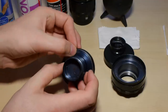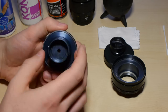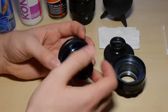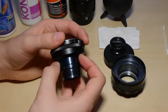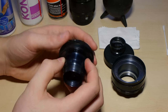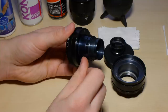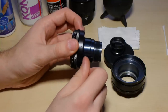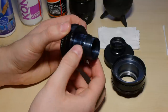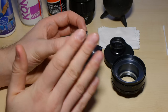You have to unscrew the limitation screw here, then remove this small screw here, which is for the aperture blades — it holds them in place and turns them. Then you can unscrew the whole body here, and if you screw it off you have direct access to the aperture control. You can also add grease under this shell here. The common problem is that there are metal parts inside with dust in there, so it starts scratching, the grease stops working, and it's not dampened anymore. If you add grease and clean up the lens completely, it works like new again.